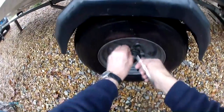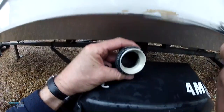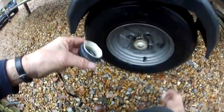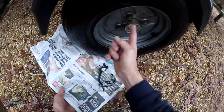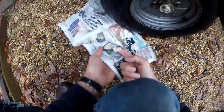So the first most important thing is flushing that engine out. The second most important thing I find is getting any residue of salt water out — look in there, just in there there's salt water in the bearings. Even though I've hosed it out, there it is. I actually messed up a set of bearings by not doing my next procedure for about three or four months, and they rusted out. I was shocked. They were probably cheap Chinese bearings, but just that little bit of residue of salt water resting in the bottom of the bearing is enough to rust and put pits in it.